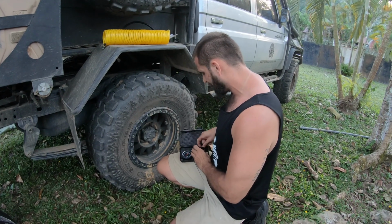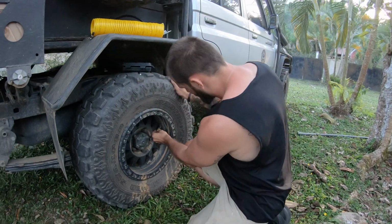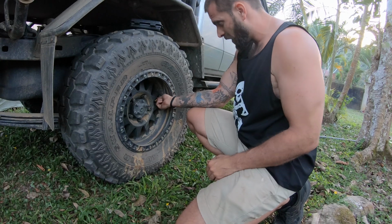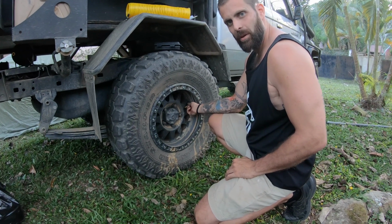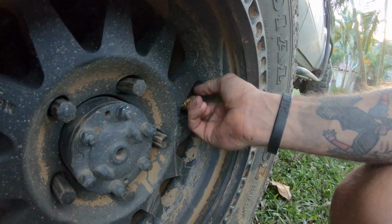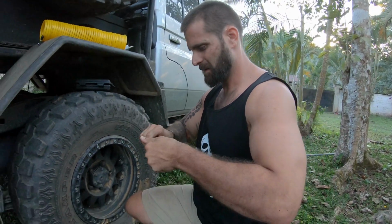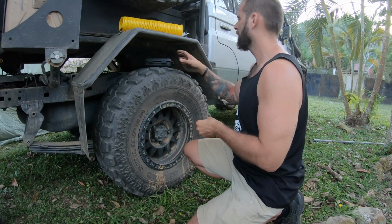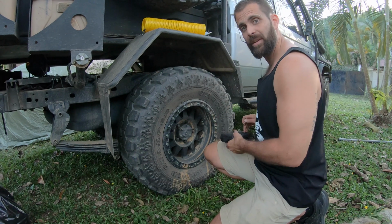And there's a bunch of companies that make deflators. This is a tire deflator here, okay? Basically what you do is, you screw this guy on here. And it's an auto deflator up to a preset level of auto deflation, okay? So you set this ahead of time, where you want to deflate, what number, what pressure you want to deflate to. And then you just screw this on when you go off-road. Okay? Good things to keep on any kind of a serious off-road vehicle.